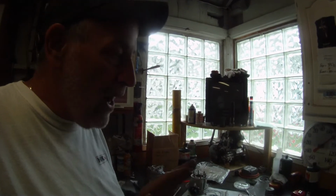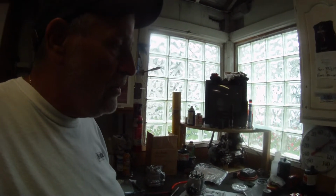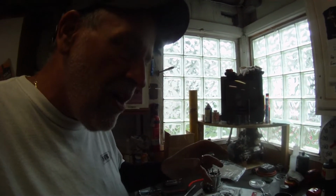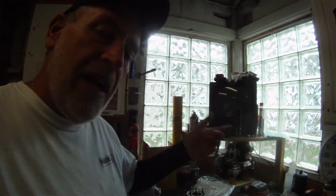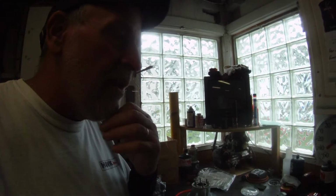It was loading up in the corners. You try to run through a corner in too high of a gear and it just wouldn't go. Back shift, get on the gas, and it would still be loaded up and work its way up to clean it. As soon as it would clean up, I'd grab another gear, trying to keep the revs down. Going to break the engine in, right?